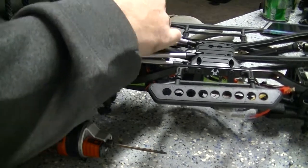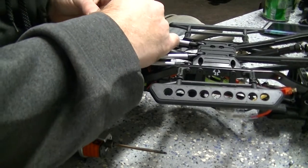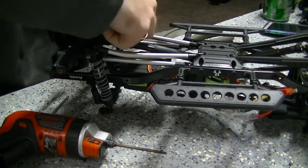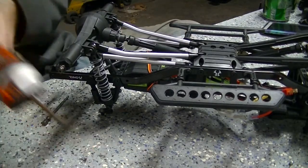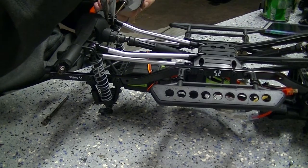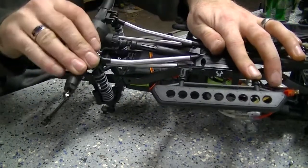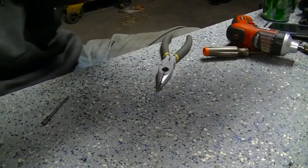So now we just gotta spread this enough to get the new spacer in. Once the spacer's in, we get our nylock started. Sometimes it still amazes me that my gigantic meat claws can still get into these tight spots and tighten fasteners. So, there we go. There's the rear link now set up, which I'm noticing that it kind of took some flex out,